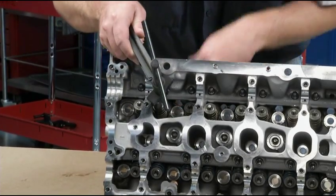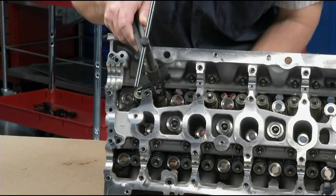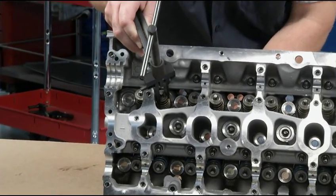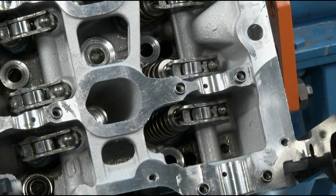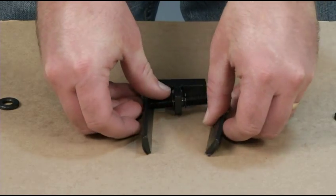This next tool is not really a new tool. You know that when you remove the valves from an engine head, you must compress the valve springs to remove the valve spring keepers. On the Skyactiv technology engine, however, a new tool is required to compress the valve springs. Actually, all that is needed is to replace the feet from the old tool with the new ones.